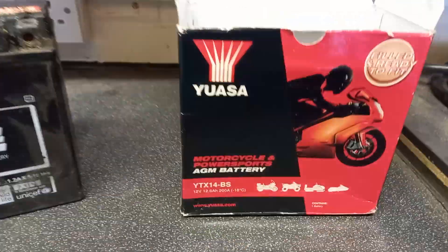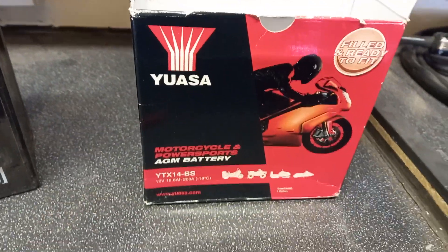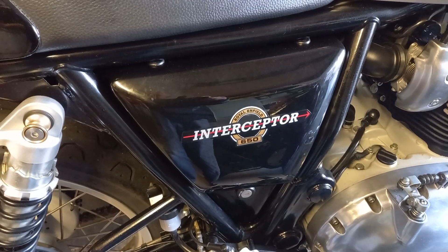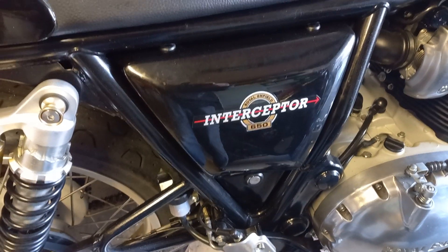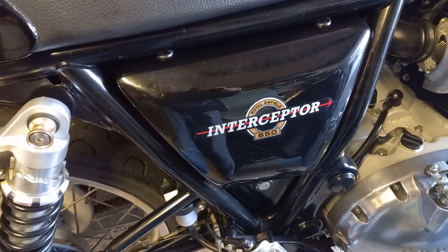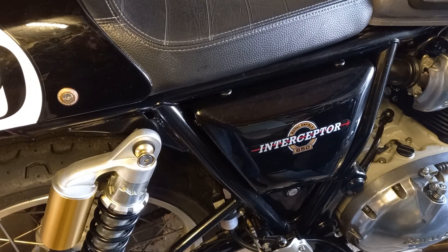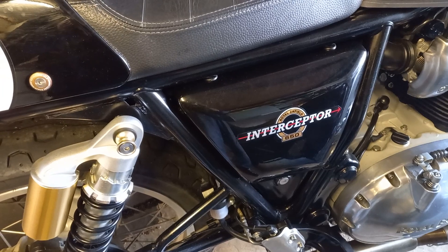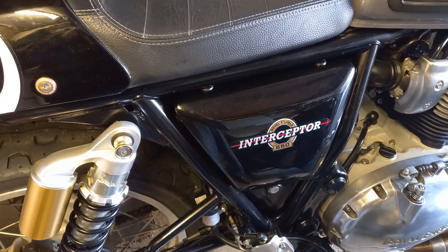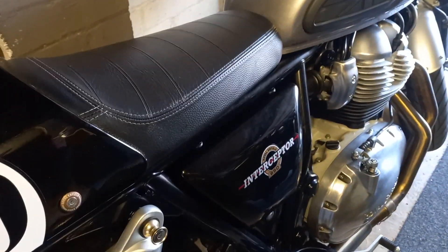That is the new battery I've fitted — there's a code number underneath that you need. You have to take a lot of parts off the bike: the side panel, the plastic plate which holds the socket, then unscrew with an allen key the screw that holds the plate in where the strap holds the battery in place. That means you have to take the seat off, the other side panel off, unscrew the two screws that hold the positive and negative wires on, and then somehow push the battery out. I found you had to use something on the other side to push the battery out because it's such a tight fit.